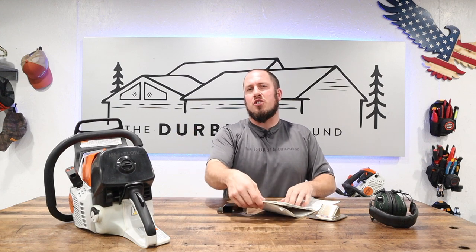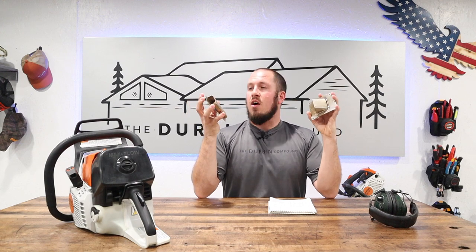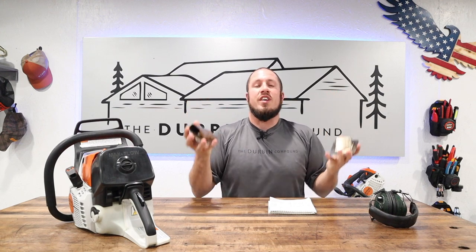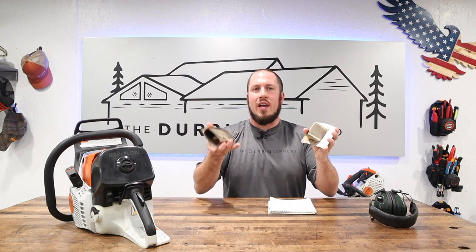So if you're somebody that's doing production falling and you're cutting all day, I'm gonna tell you right now that both of these covers are too loud. They are wicked loud, and even with hearing protection on, my ears still ring after running them. Unless you want to do double hearing protection, if you're running the saw all day, these are not good options. They're just wicked loud.